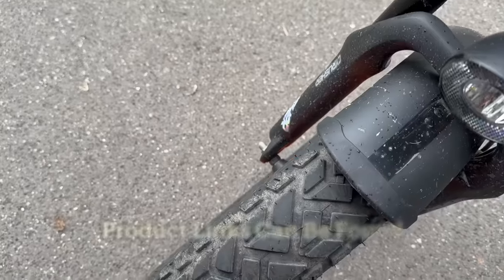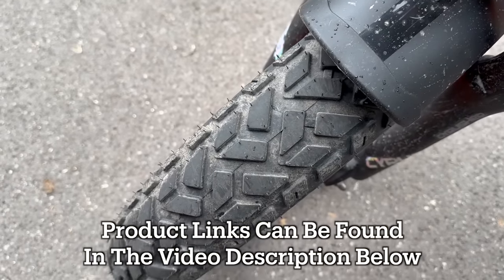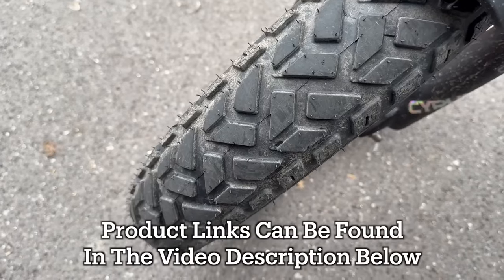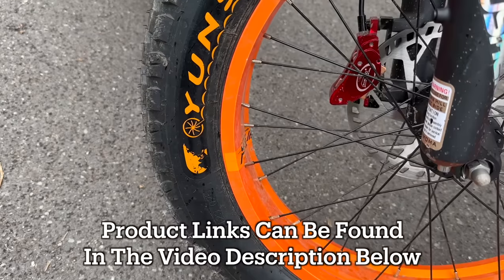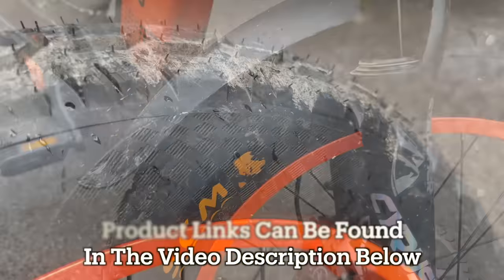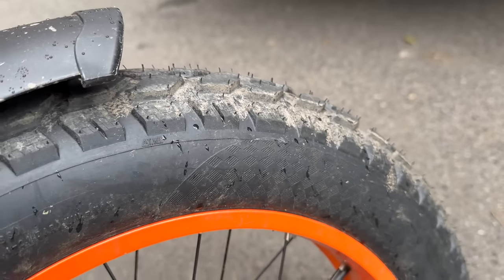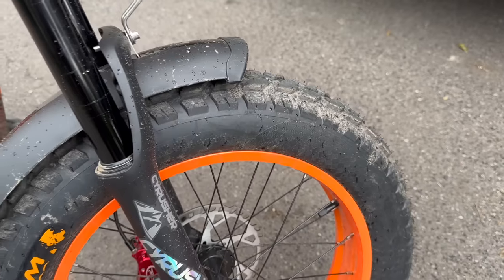But the buzzing got to me a little bit, so I've upgraded the tyres on it, which are a bit more sort of badass BFG KO2 kind of tyres. So bigger knobbly bits in there, which means they're actually better for on-road and actually better for mud and gravel and things like that. So they've got more depth tread to grab and move the gravel around. And it does also mean that they're better for punctures as well.